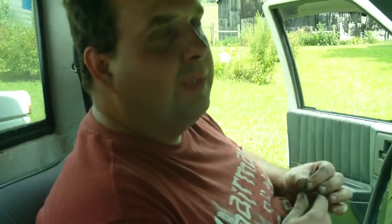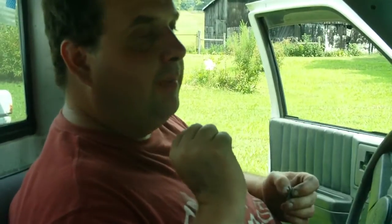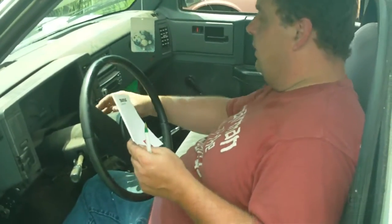And you want your book to write it down. Code 12 is a basic code. It pretty much tells you everything's normal. Like I said, when you have a code 12, it'll come on, flash once, then go off for about a 2 second pause, then it'll come on, flash, flash, and that's it. You'll have 3 flashes with a pause between the 1 and 2. Okay, as I said, always have your ink pen or a pencil and a piece of paper. Write down the code.